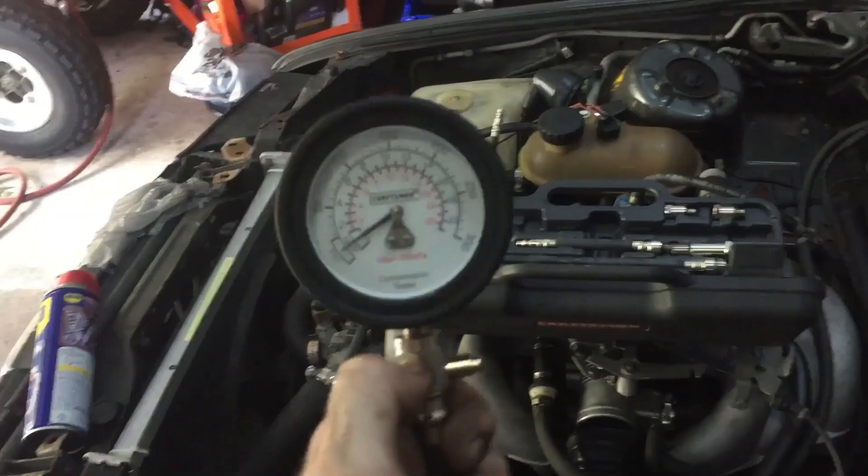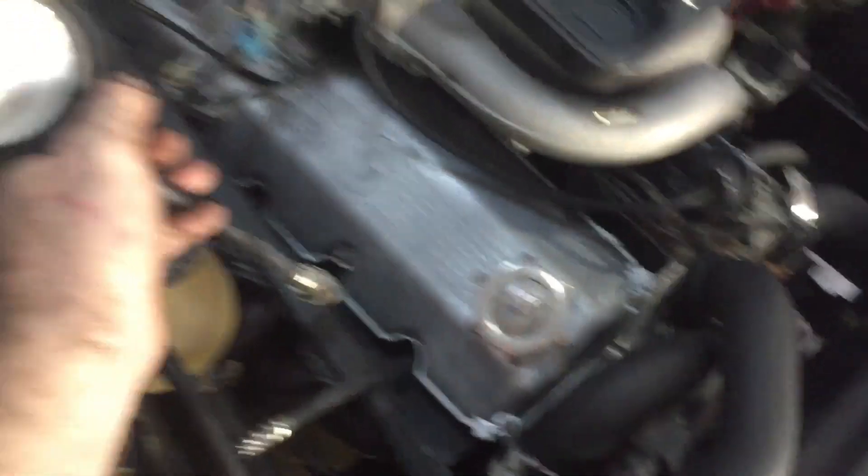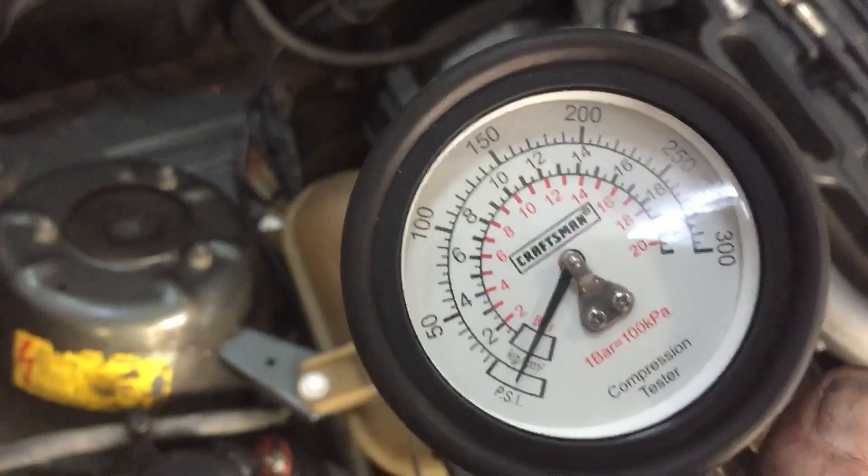What I would do is go into the car and turn the car on and have it crank — turn the key over two, three, four seconds. That's it. You don't want to keep cranking the car. You're only running on five cylinders because each one of these is taking up a cylinder. Then I come back over, get a number from the gauge, and I write it down. Okay, cylinder one. Then I go to the next cylinder, go back over and crank it, come back and read the gauge. Okay, cylinder two.